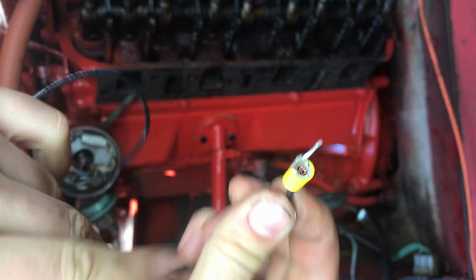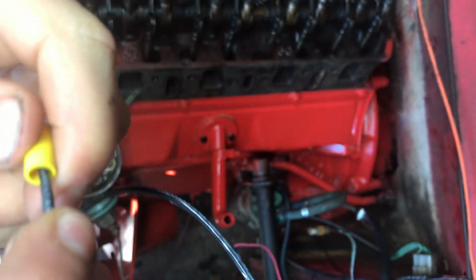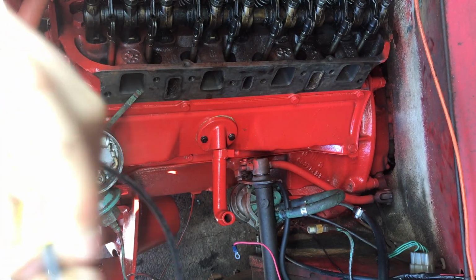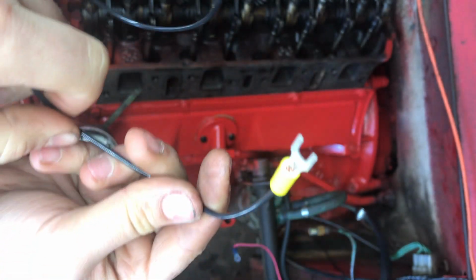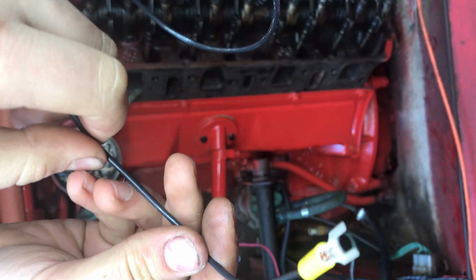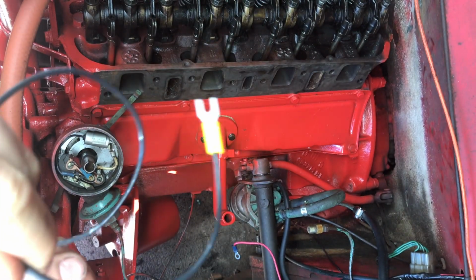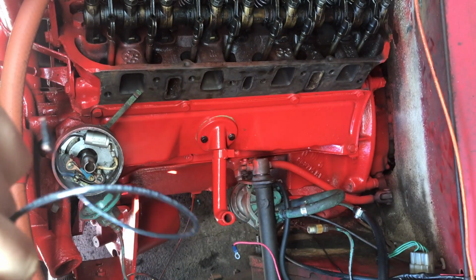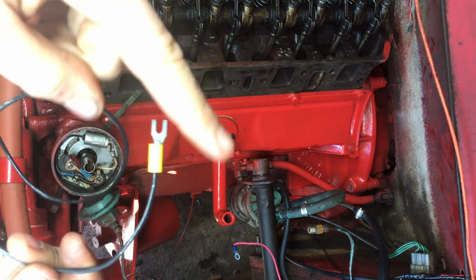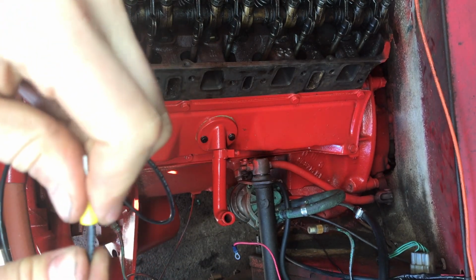And there you go. So you see I got my bundle of wire down there, and it's a nice tight connection already, and when I crimp that down, it's not going to go anywhere. So that's just a little trick I've picked up to make sure wire terminals don't pull apart if they're ever under pressure, they got tugged on, or something fell on top of them for whatever the reason. So it's just something I like to do just to ensure. And if you want to, you could even wrap a little bit of electrical tape around it, and that helps too. But in this situation, it's already tight enough, I'm not going to need it.